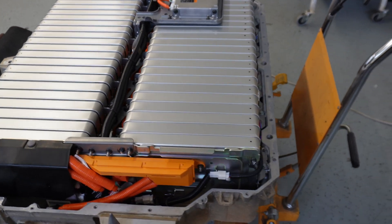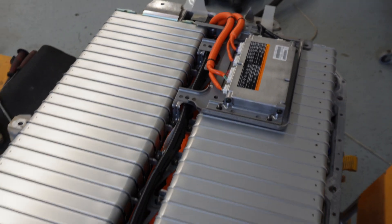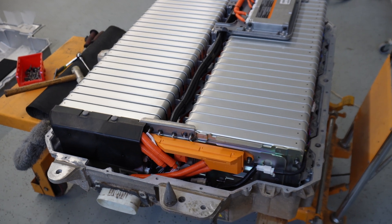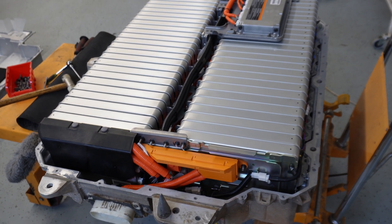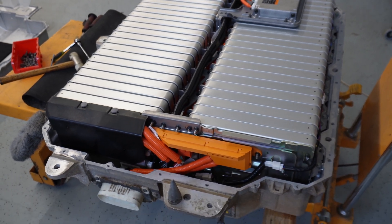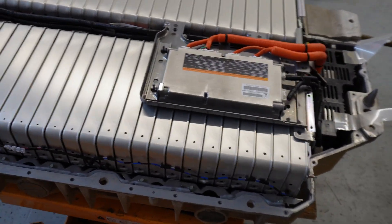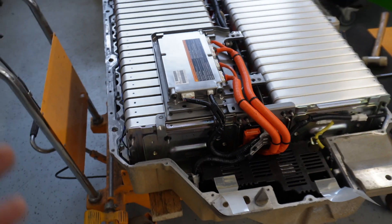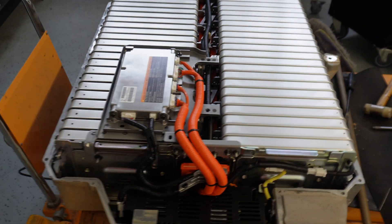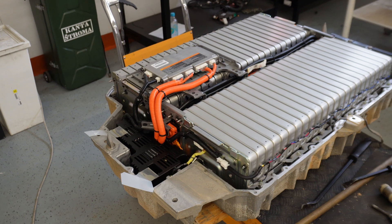The cells are not replaceable. Now we will analyze high voltage wiring, low voltage wiring, and try to replace all the cells with a new system. We need to design the new system on the old wiring, to see where cell number one through 96 are located. So we will need to sketch everything, design everything, and go step by step marking the wiring and all the sense wiring, to see where we can place the modules and how to route the wiring.